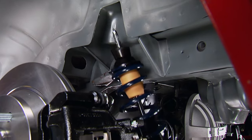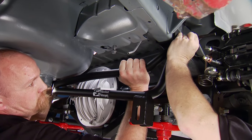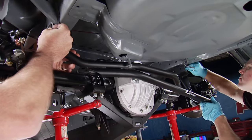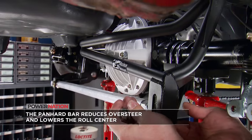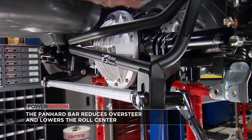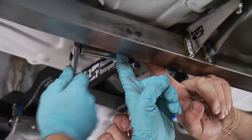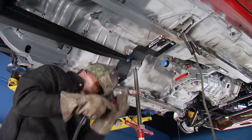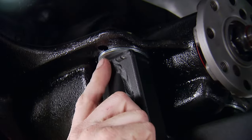With the rear coilovers out of the way, the Panhard chassis bracket can be installed. It attaches to the subframe rails and requires four holes to be drilled; frame inserts will keep the frame from collapsing when tightened. The aluminum Panhard rod keeps the rear end centered in the vehicle since the upper control arms are not in use. The torque arm crossmember uses four bolts and six tabs to secure it to the frame rail. With the pinion angles checked, the tabs get welded in. The gross pinion angle is set by the height at which the crossmember is installed; shims allow further adjustment up or down.